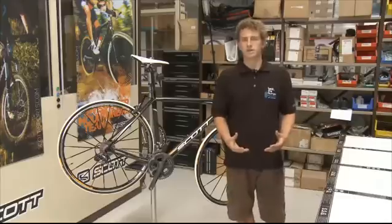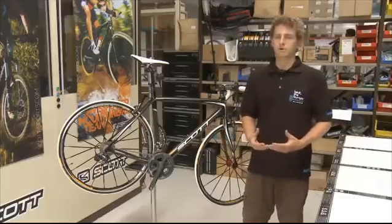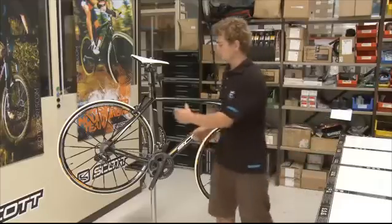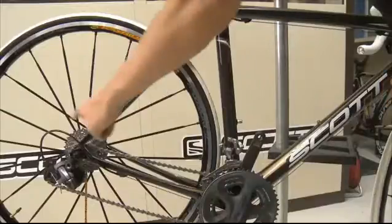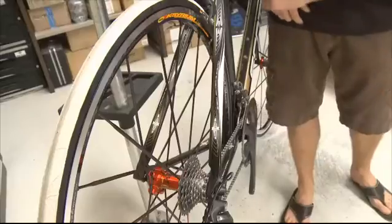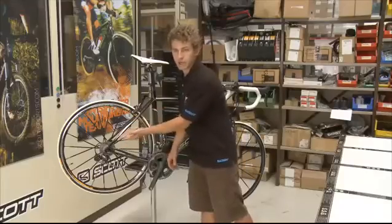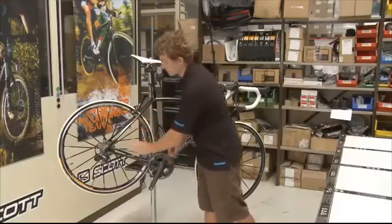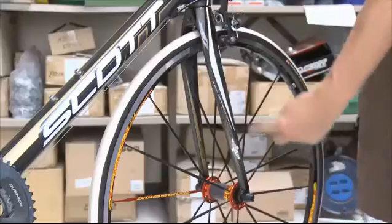For this, we have to work on two factors. First, the frame stiffness calculation — we work more on the shape of the tube. Here it is, the rear triangle. We work on the tube shape, the forms — it looks like a muscle. What we call the S-band tube shape. The goal is to allow a deformation up and down in a closed rear triangle. We implement this same technology on the fork.